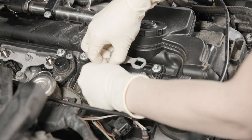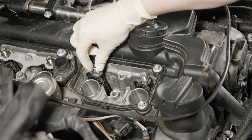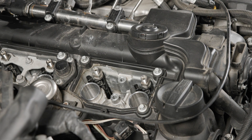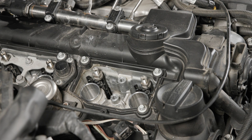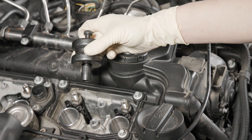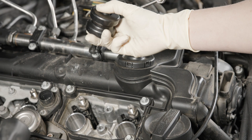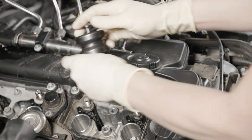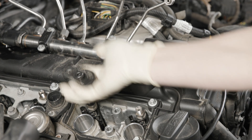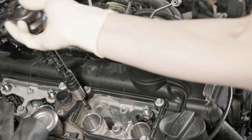Go ahead and pull that off and then you can see the injector. This is the injector we're going to be replacing — cylinder two. Definitely pay attention to which way the connectors face so that when you put it all back together, you don't have it facing the wrong way. This is a puller that I like using. There are a couple of others available, including a BMW-specific one, but I like this because it's a little more compact and easier to use. It just screws onto the threads of the injector, and then you can slide it out just like that.